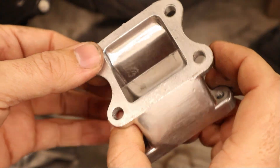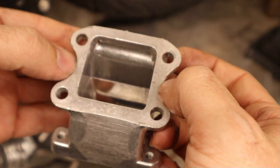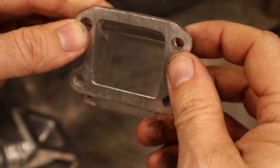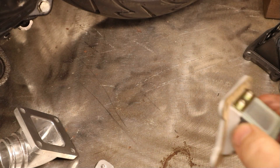This side is a little harder to do, but at the very least take a very fine file and just take those little casting lines off. That will help immensely. Also, run the gaskets. Some of these are quite cupped around the ears, so even if you run a gasket, if you don't level out the edges of the casting, you still end up with a dip in the sealing surface, you get air leaks, and your motor goes kaput. This one definitely soft seized at one point.